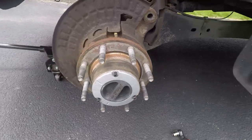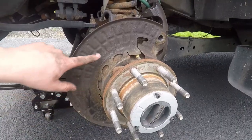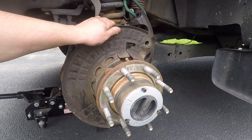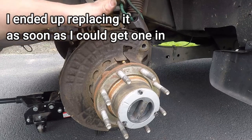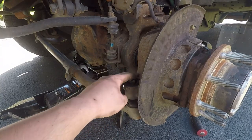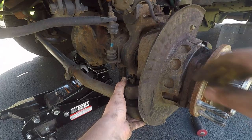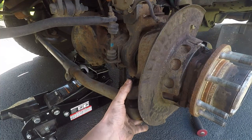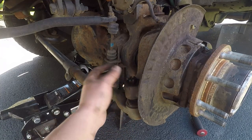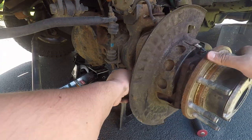The next thing is this cotter pin pulls out, then this bolt, and we take this out. This dust shield is a rusty pile of crap — I don't have time to wait for a new one so we're going to run it, but I'll have a link for you guys to replace it in the description. This is your tie rod end — 21mm castle nut. I took the cotter pin out and I leave the castle nut on there to protect the threads, leave it just a little over top, and give it a few light hits. It'll drop and catch so it doesn't fall and hit stuff, and you didn't mess up your threads.